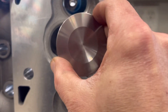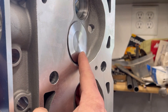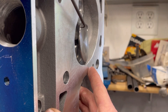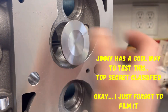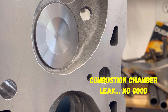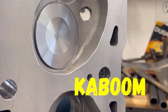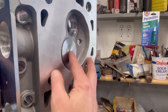When you come in here and put these in, you want that to seal as these are going up and down. On the seat itself, right through here — it's not actually sealing all the way. That's going to cause a leak, less combustion pressure, less of everything. When you're building a street strip high performance motor, you want these valves to seal properly so when it ignites, you've got that cylinder pressure burning off and everything is opening and closing correctly.